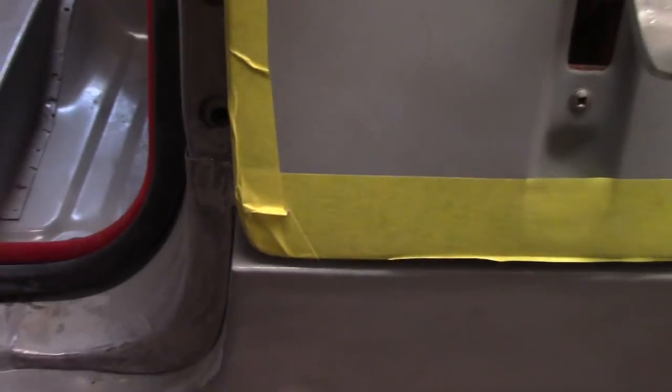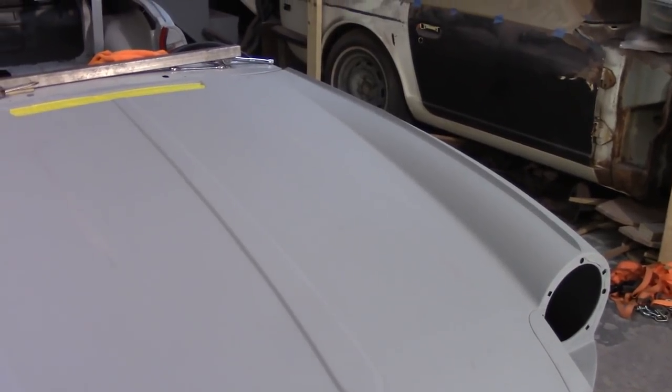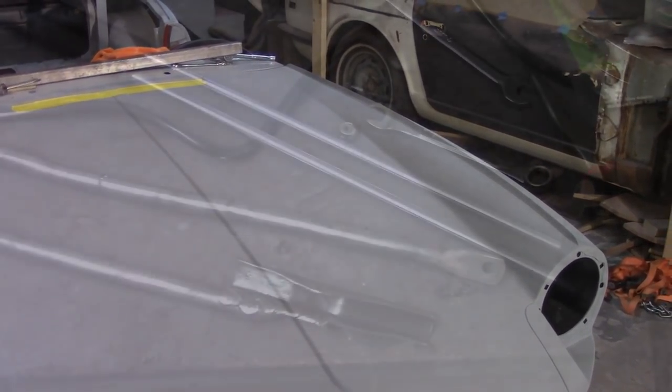I do think that center support needed to get in there and needed to get adjusted, and still probably needs a little bit more adjustment. This gap has opened up a little bit, closes up in the center and it's relatively closed compared to the other side, so that tells me that part of the bonnet over there can still come back a little bit. I still have some room — it's going to be close. What a headache. But I'm coming along — tomorrow night's my actual full visit so I'll have another wonderful five or six hours to play with this stuff. Until then, I'll see ya.